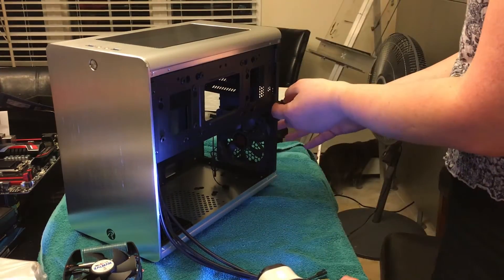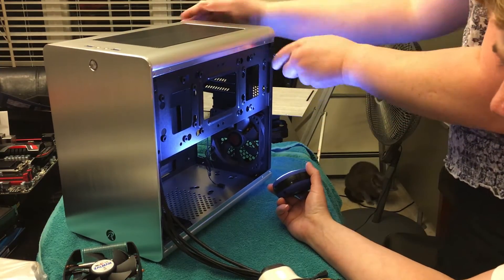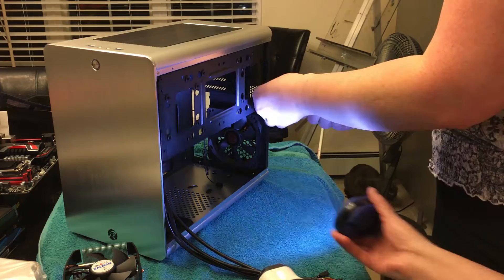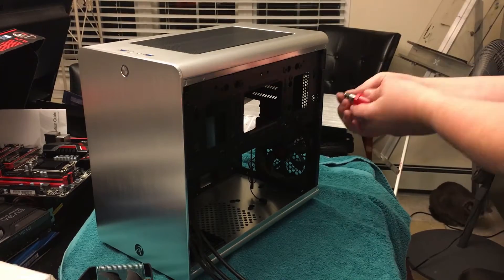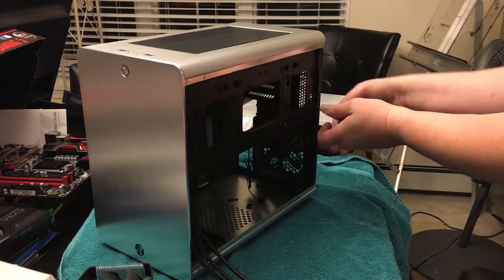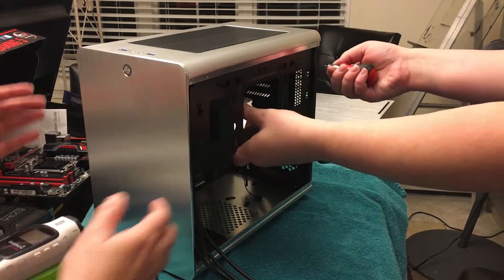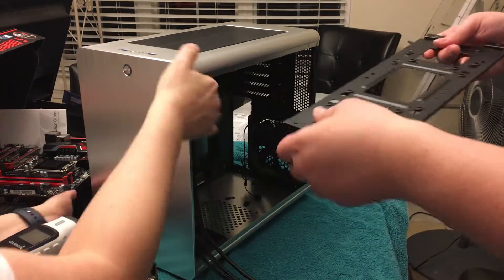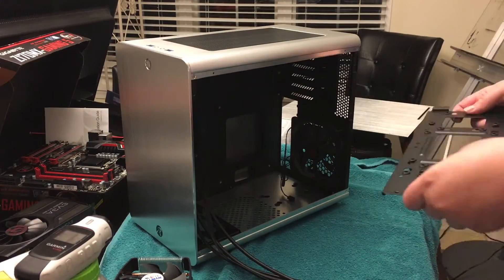Step 1: open the case and remove the drive tray. One point about this piece is the screw is a little tight, but once you give it a turn it's fine. On the little grommets, remember the smooth side goes out. Actually, it's easy to remember because there's a lip that goes against the case. Put this off to the side for now — it goes back in last. Now with all these connectors we have, it looks like the audio connector and this is USB.